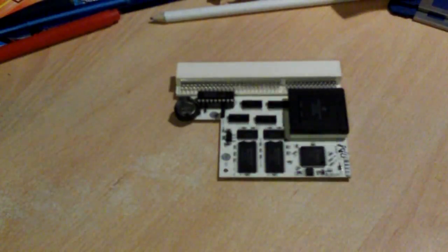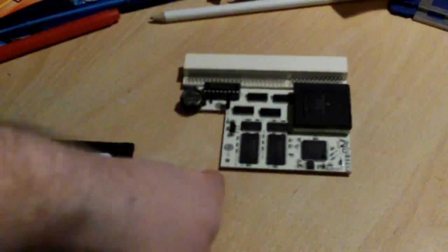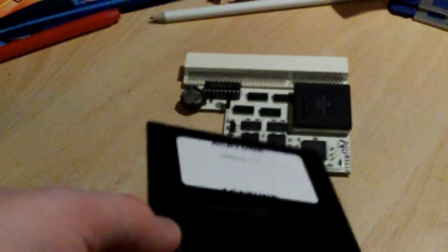I've heard a couple of comments about people talking about what was in the box. So I've got obviously the accelerator, and ACA Tune. Basically if you have Kickstart 3 — not 3.1 — you need the software to make the machine recognise how much RAM this thing has. Because if you put it in and you don't install and run this, it comes up as 500-odd megabytes of RAM, which is useless. So if you didn't get this for your install and you don't have a PCMCIA transfer card or something like that, you're basically stuck, because you need this if you've got Workbench 3.